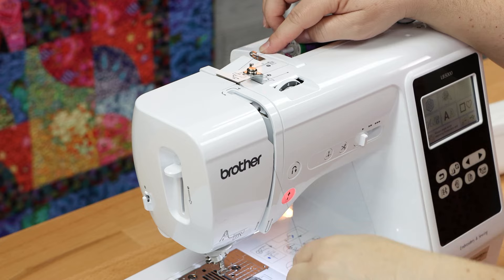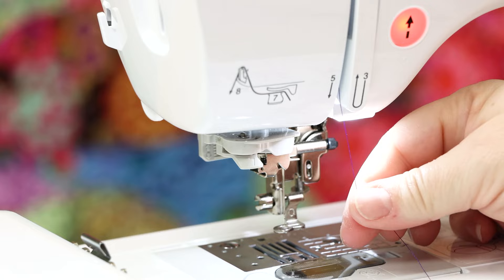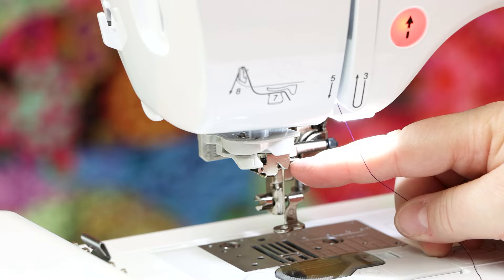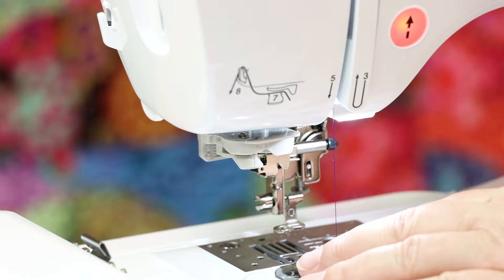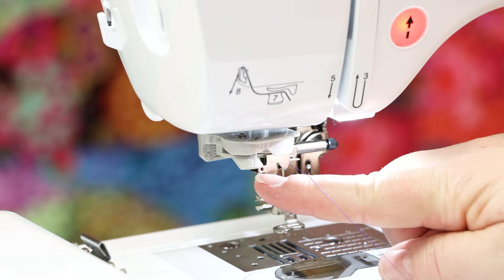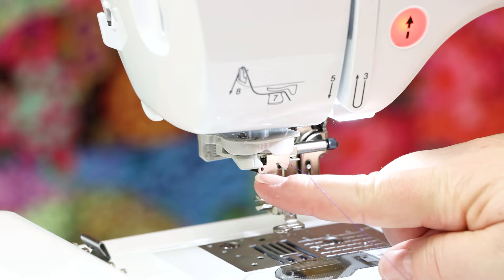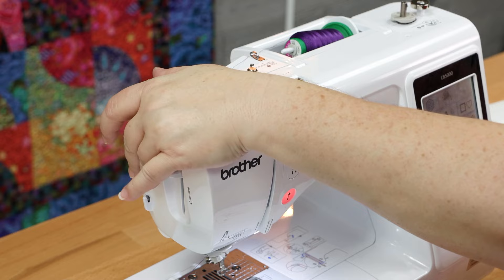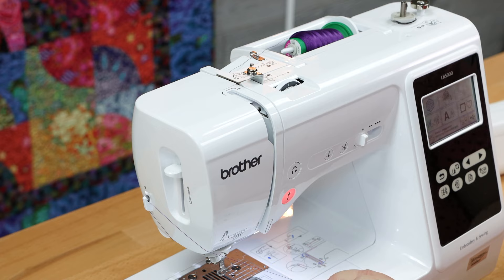Right here is number five, so pass by number five. Now at number six — this is the needle bar. On top of the needle bar, there's a little piece of metal, and the thread needs to pass between the needle bar and that piece of metal. If you've got some tension on your thread, this is very helpful. From there, pass up towards number seven — kind of pass in between this little slitted area and up into number seven, which clicks in on the far left-hand side. Over here on the side of the machine, you have a razor blade. The thread comes up and around that razor blade, and you pull on it to cut any excess thread.